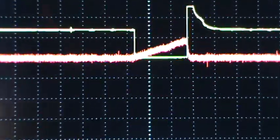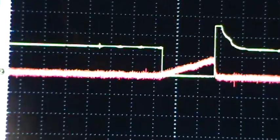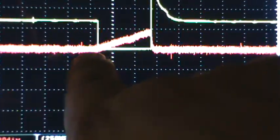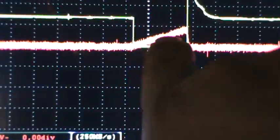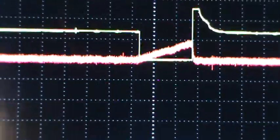That would be good, because a fuel injector typically pulls about 900 milliamps, which is 0.9 amps — so you're looking at good amperage, meaning this fuel injector is flowing fine. Notice the amperage rises in a nice steady incline. If the amperage shoots straight up very fast instead of a gradual slope, that indicates the fuel injector is shorted.